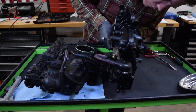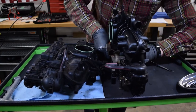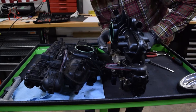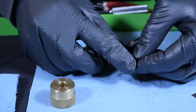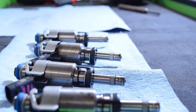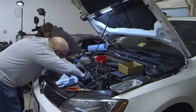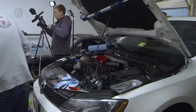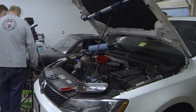Now that we're ready to put the new intake manifold on, I was swapping parts from the old one — putting the fuel rail on as well as some vacuum lines. We also replaced the injector seals since the injectors came out of the engine block. And lastly we did a carbon cleaning because this car is at 80,000 miles and the carbon buildup was awful.